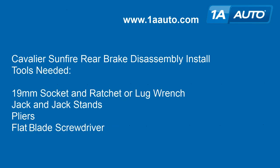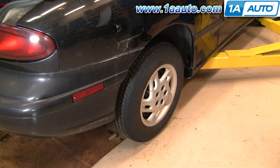The tools you'll need are a 19mm socket and ratchet or a lug wrench to remove the tire, jack and jack stands, pliers, and a flat blade screwdriver. And this is pretty much what you need for any vehicle. You're going to want to raise the car, secure it, and remove the rear wheel.